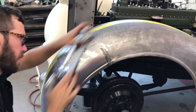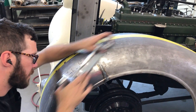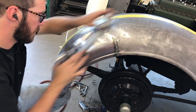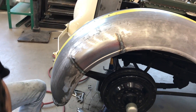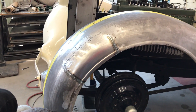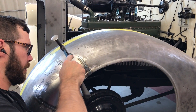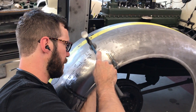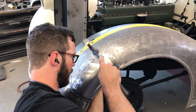We really are old-fashioned here at A Road Less Traveled with Restored Cars. We like a hammer and dolly and file. With the file you can tell your highs and lows so quickly and easily, so you knock down what little bit of weld is there, and while you're doing it you might as well go along and planish it back out. We also have an antique machine that's a little portable planisher for fenders that we sometimes use, but this methodology is great.